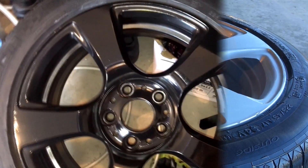Most of the top is covered but the sides are still peppery. Make sure the paint on top doesn't run down the sides while they're still dry. There's some curb rash visible but I just wanted to get it black, so that's fine. Wait 10 minutes for it to dry to the touch and then do your next layer. For the final layer, spray it just thick enough so all the little beads of paint stick together and form one continuously smooth surface.